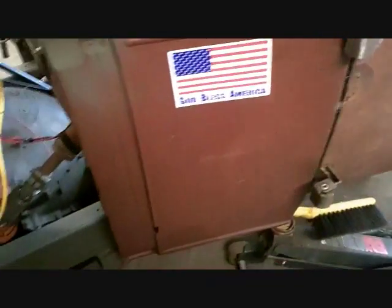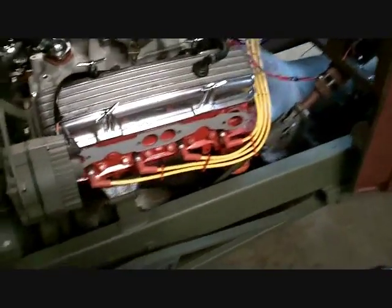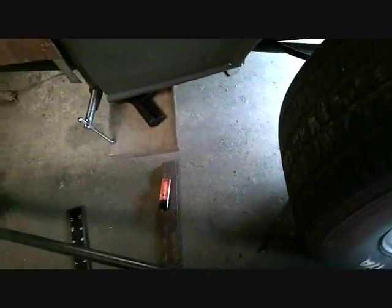That will also make up for that three quarters of an inch. The front gap is getting better and better. I do have to make the holes in the A-pillar post bigger so they'll be slotted. I have the exhaust manifolds off — they're in the back of my wife's car, going to be TIG welded and sandblasted. When that's done I can start connecting the cherry bombs up under the frame through the back, probably make a corner and come down out the side.